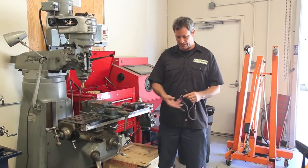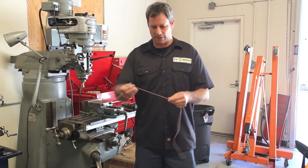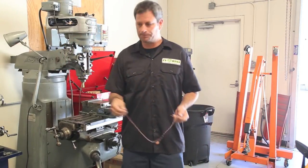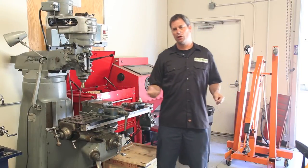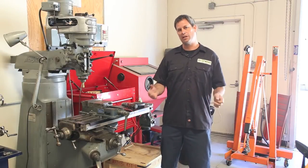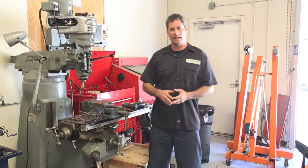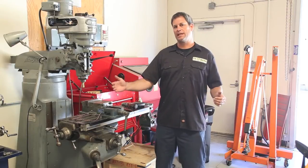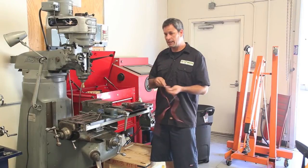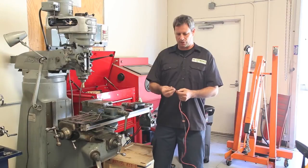What I want to do today is show you a really quick method of creating twisted pair wire for yourself. This is the type of stuff you even find as factory wiring in vehicles — it's nice braided wire, gives you a real nice look. If you're installing our Link Pro or Xantrex, anything connected to a shunt, we recommend this type of wiring be used on all shunt applications. So what we do is measure out the length of wire that we need and add about 20 to 25% to that length, because when you twist the wire it's going to shorten it up. Cut two pairs of 18 gauge wire in equal lengths.